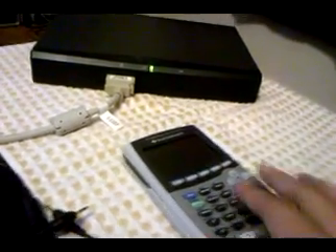So, back to the calculator. The way it outputs to the TI Presenter — or the presentation, like I should say — is done a couple different ways. One is the actual view screen connector, which connects the LCD controller in the calculator directly to the TI Presenter, which means it's all done in hardware and the calculator doesn't have to do anything at all to output its contents to the LCD. The other way is the presentation link adapter. And because it's a USB peripheral, the calculator has to initialize it, set it up, and enable its extra hardware, which is present in every 84 Plus and 84 Plus Silver Edition, which will automatically mirror the contents of the LCD through USB directly to the presentation link.